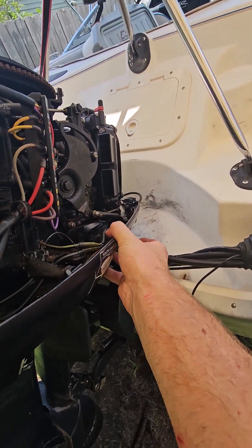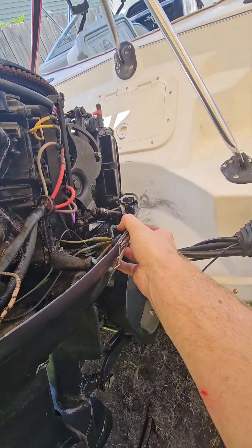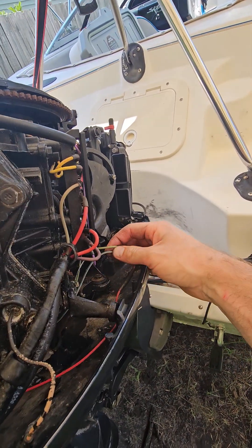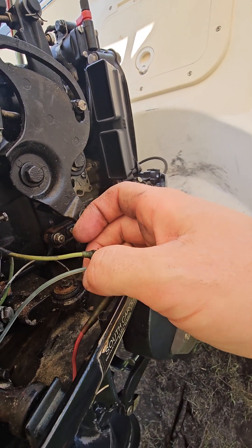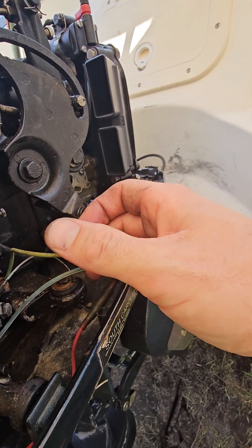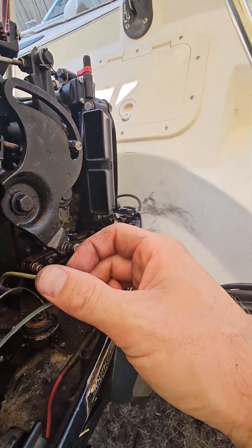So that's my up, trim, down. You can hear it engaging, but for up I got absolutely nothing. I thought originally it was a switch, so I tried to replace those. Nothing happened. You can always take these two wires right here — if you swap them around you can test up or down. Whenever I switched them the unit would still not go up.